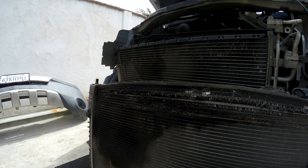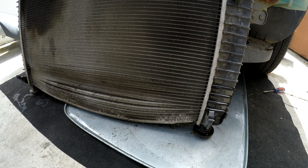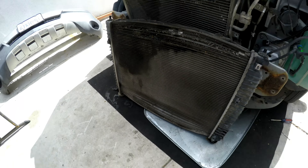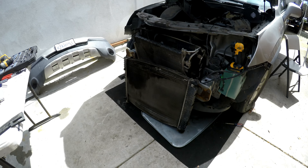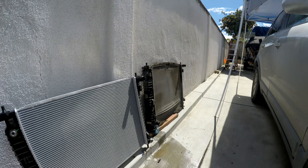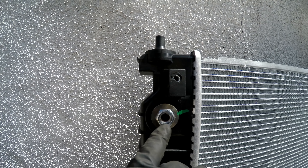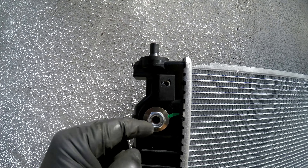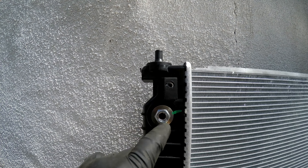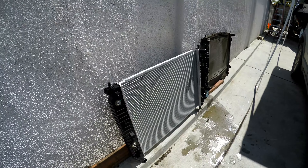And here's your radiator out. Here's our new radiator versus the old one. The cooler lines already have a replacement o-ring inside — we just got to lube it up and the retainer is already installed. There's a little ramp on the cooler lines which will expand the retainer and it will lock on once you push it in far enough. So let's go ahead and install the radiator.